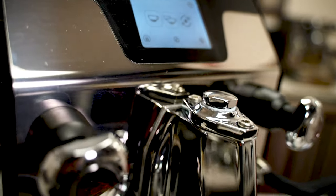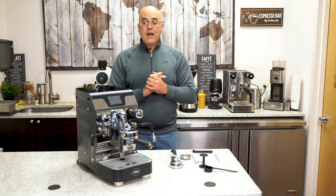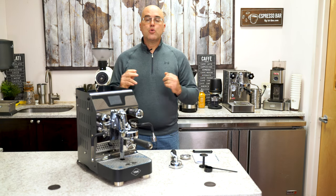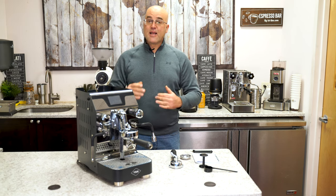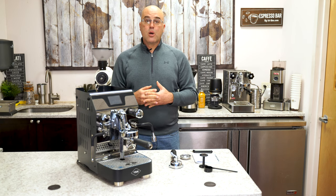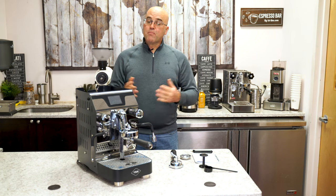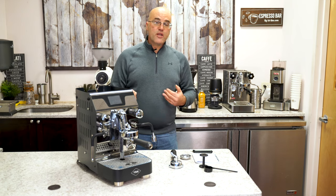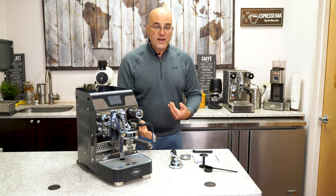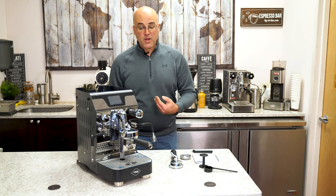I worked with VBM to make some improvements, which they did, and I'm very happy about that because the machine did need some improvements — I can go over that in another video. What we have here today is their new dual boiler espresso machine that has pressure profiling that can be programmed with flow control and a gear-driven pump. It also has electronic dosage, which you don't really see on other machines. There is no lever on the side group head to turn espresso on and off, but the machine can be programmed to measure how much water flows through the group head, turning it off automatically, along with programmable pressure profiling.